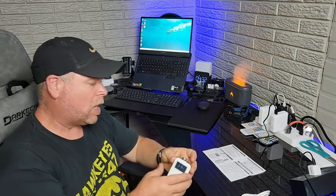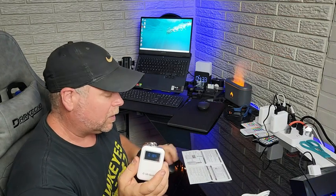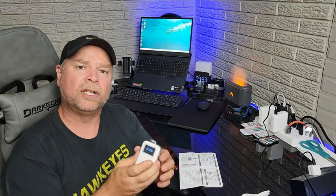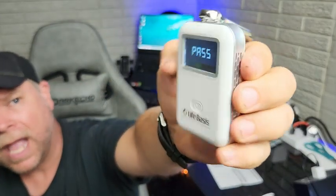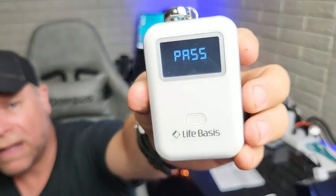As this counts down, the alarm may go off. If your alarm goes off at an unexpected time, or at a time when you know it is not really carbon dioxide, you can simply press your power button twice to turn that alarm off. We'll hold on here for just a minute and make sure this is recalibrated — it should be around 400 or less. The recalibration process is just about done, and we passed.